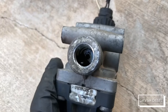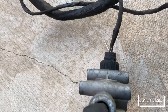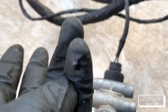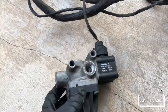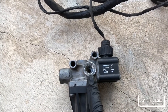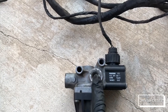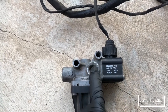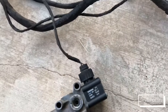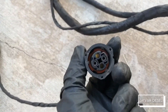If you pay close attention, you can see there's oil inside this valve. That means you probably need to replace the air compressor or replace the air filter cartridge in the hub and the air dryer. Pay attention to this. If you have any open circuit related to this valve, you can see it only has two wires.